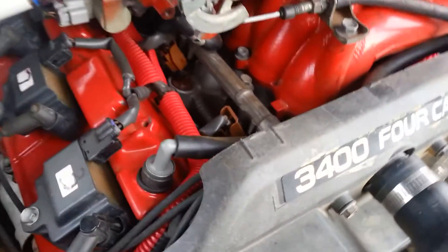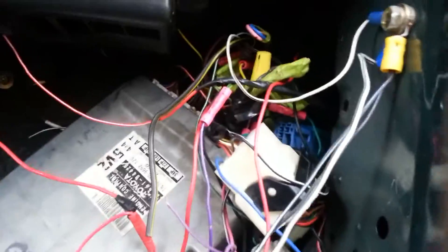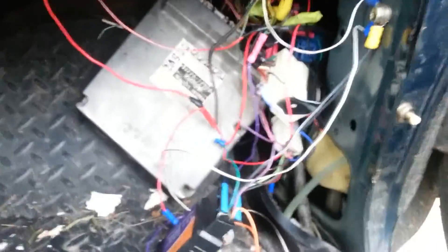What I had to do was trace the wire back. I've got an electronic wiring diagram and I was able to trace it back to my ECU and find out where the wires went. It's nice and messy, but it works and it runs like a top, believe it or not. I found out which one was my ground and which one was my signal, and I cut the signal wire — I don't like cutting wires — but I had to. I spliced two longer wires onto it and ran them over to a point meter right down there.